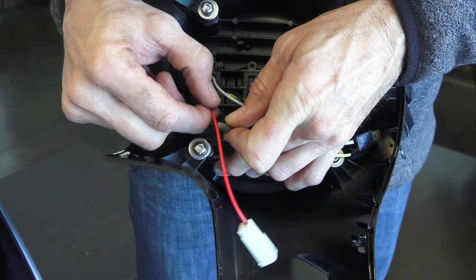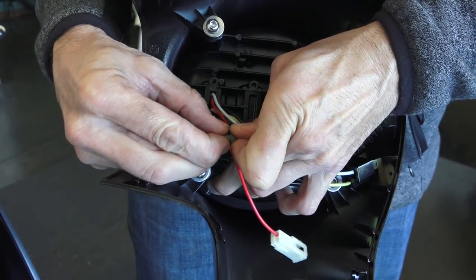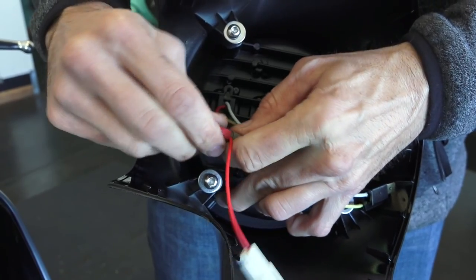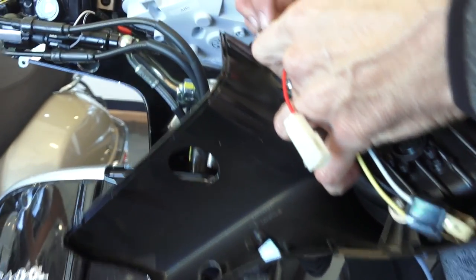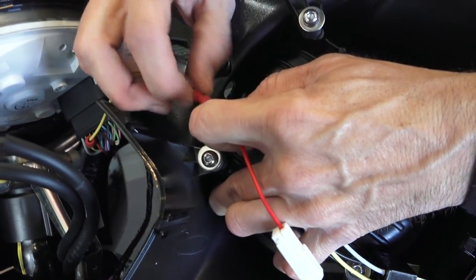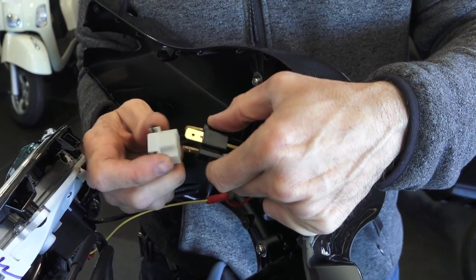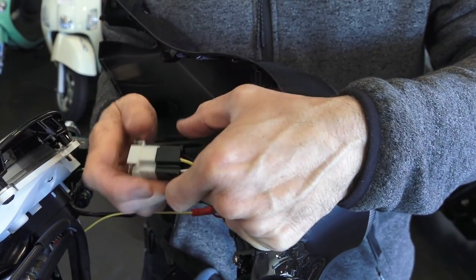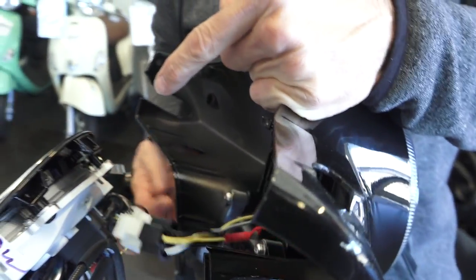With the red wire on the new headlight housing, use the second posi-tap: open up the red section and insert the wire, then tighten it down. Take your headlight connector and plug it into the mating connector that comes off the new headlight assembly. As an optional step, you can wrap the whole assembly in electrical tape — they're quite secure and don't really come loose, but if you want to further insulate it, you could certainly wrap it.